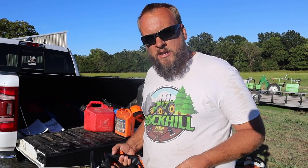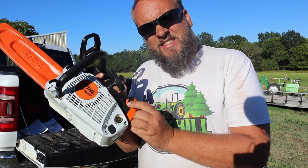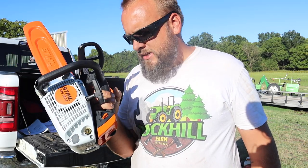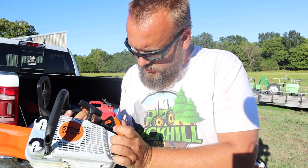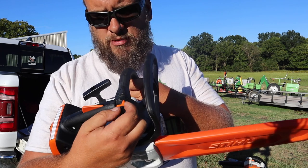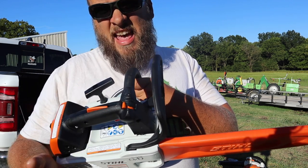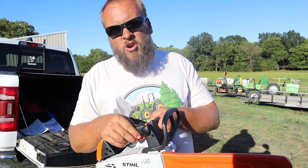After reading the owner's manual, I do see something unique or different. Down here you've got your primer bulb like normal. Here, instead of having three positions, you have a choke and non-choke. All my other saws automatically turn the choke off when you pull the trigger — this one does not do that. That is one difference. Now, the other thing that's different is this top button right here. You have a saw stop by pushing that forward, then a run position, and then there's a throttle lock position that you can squeeze and pull back. It's in throttle lock position now. It seems like you wouldn't ever want to lock the throttle on a chainsaw, but this is used for starting the saw.